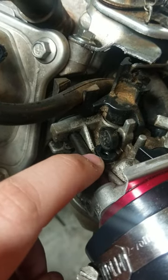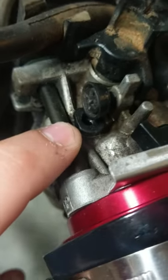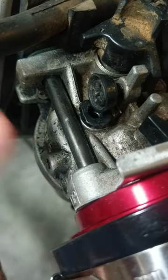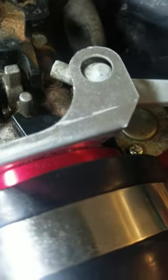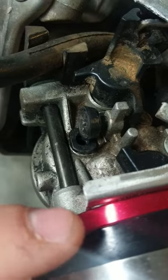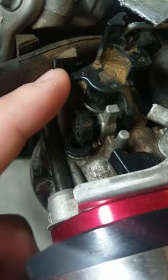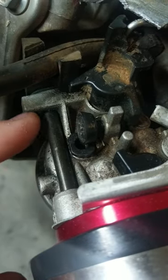But if you're ever having any major idling issues, there's another one right here. You take out your idle adjustment screw, and then it gives you access to this jet right here. You pull that straight out, you can clean it, you can blow carb cleaner through it. What that does is it allows air to bypass the choke butterfly in here.